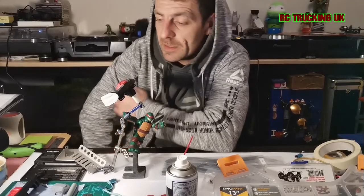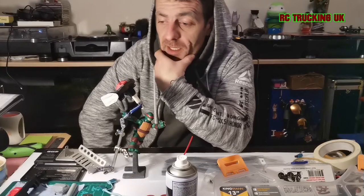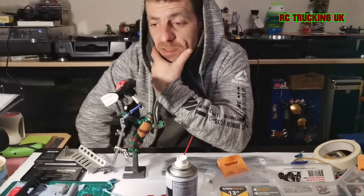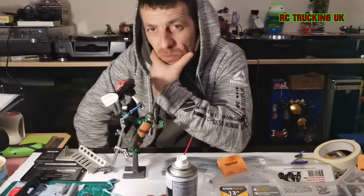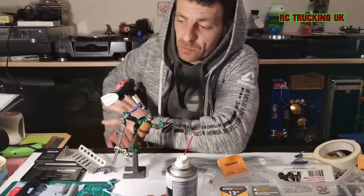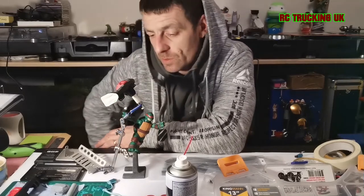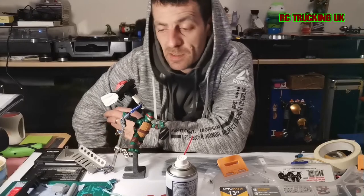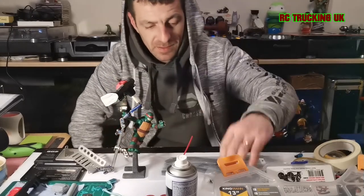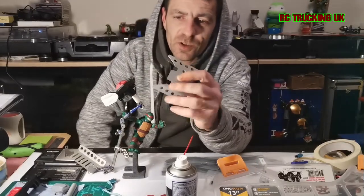The diff covers have been done — I've etched primed them because they're brass; otherwise the paint will just start flaking off straight away. Yes, it will all get scuffed later, but to me that adds to the character. It's basically going to be a shelf queen, but I don't build shelf queens — I use them regardless. So I'm doing the opposite of what I'd normally do.